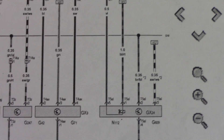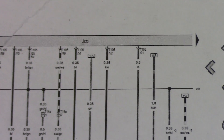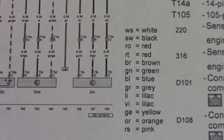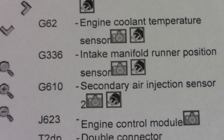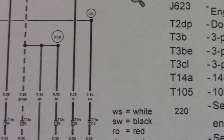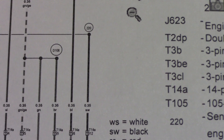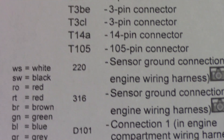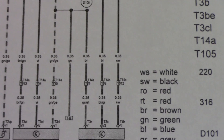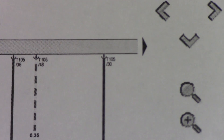The other wire on G28 is pin 2, and that is pin 70 on the 105 connector of our J623, which is the ECM. G40 is our cam sensor — also a 3-pin, another hall effect. There's D108, and then there's wire 220, which is a sensor ground. The other spliced wire is our 5-volt reference. Pin 2 goes to the ECM, connector 105, pin 30. So that's coming up next — cam-crank correlation.